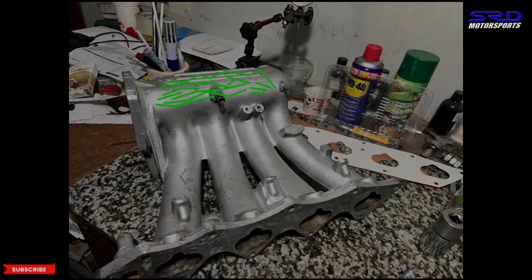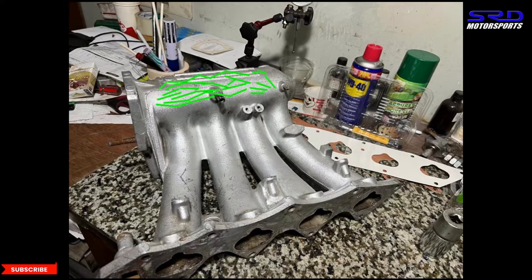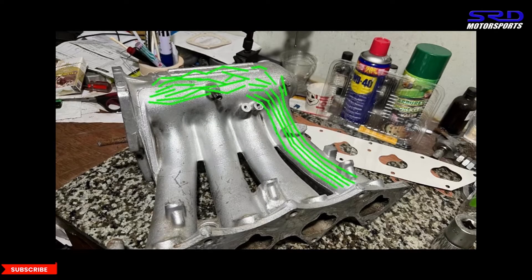Filling up the plenum really well is really important. Cylinder number one fires, gets efficient, then three, then four, then two — that's the firing sequence. You can have all the things really good, but if the plenum volume is not filled really well, we're going to have inadequate flow or function on each cylinder. To reach good plenum fill, we have to understand the intake pipe.